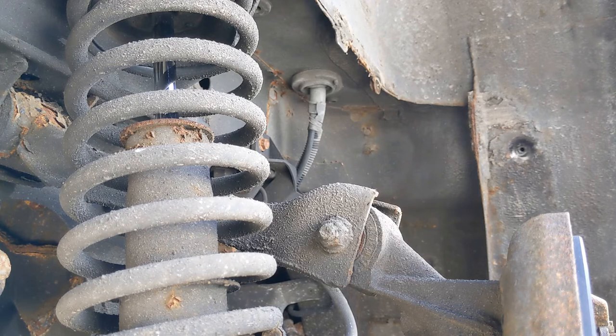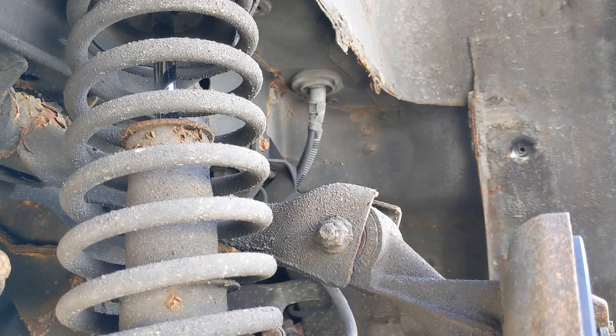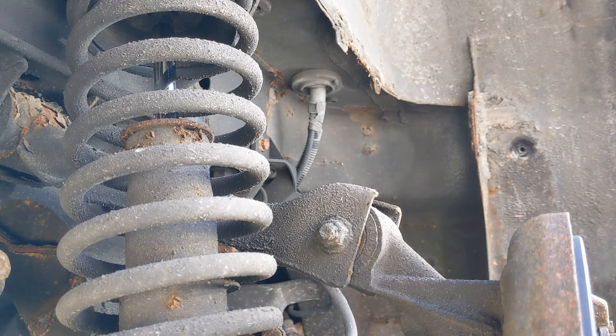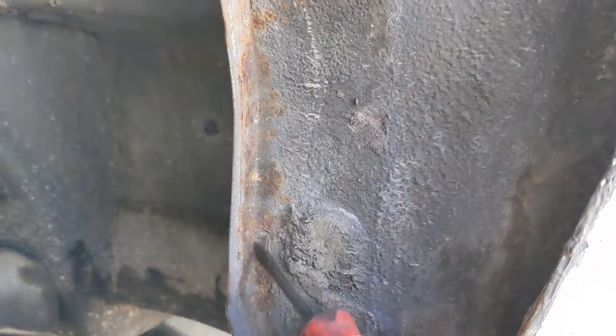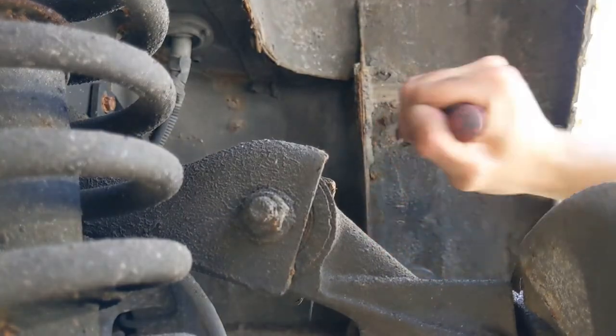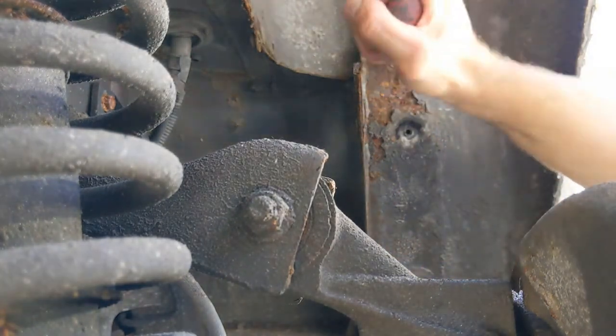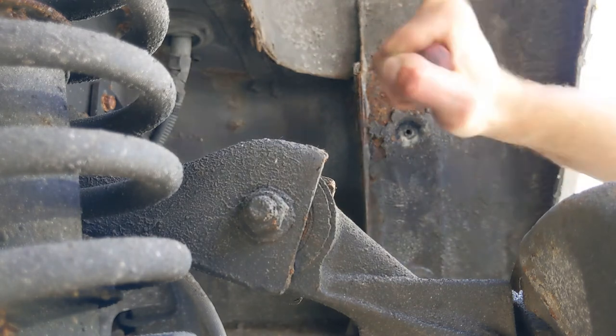I'm going to get a little screwdriver and just have a stabby stab to make sure it's solid. Then we'll start grinding - I've got some wire wheel adapters for the grinder to clean the rust up. I think I'll get my pressure washer out with some cleaning solution and some stiff brushes as well. Coming in here, we can see down there there's a patch of corrosion starting to appear, and all up this fold as well - a bit here starting to come through. We'll give it all a tap - you can see the top layer of corrosion coming off but underneath is still pretty solid.